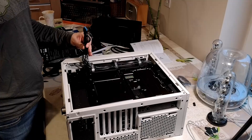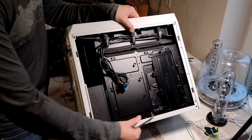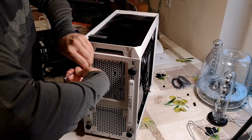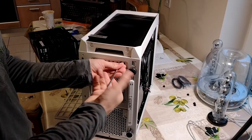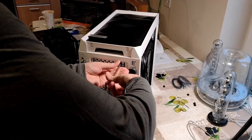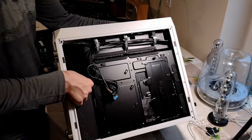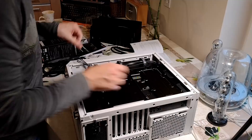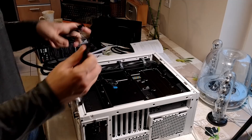We can't put the case cover back on here with this fan in place. It is time to start hooking up all these power cables. The problem is this is where the power cables have to get plugged in and this giant hard drive thing is in the way — and we don't need the hard drive thing. Simple problem, simple solution: rip the hard drive thing out. There's just four screws here — we rip these out and that whole hard drive tray will go. Bonus: we get four screws that we'll have no reason to use. There'll be a thunk noise as the hard drive tray hits something, but that's completely anticipated. Put back in the dust filter.